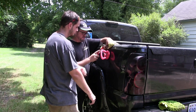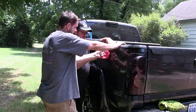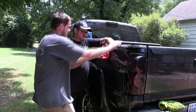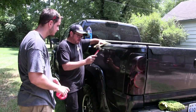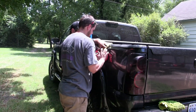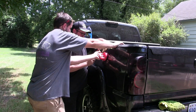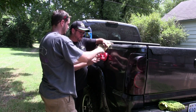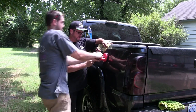I've went around and relaxed the metal, and now I've got him put the suction cup on. I'm going to continue hitting that metal, and then I'm going to have him put a little bit of pressure on it. I'm hitting right on the top of where that crown was — that eyebrow — to push the body line up, because if you don't do that, it's not going to pull out near as easy. He's pulled some out, and now we're moving down towards the center of the dent — the bigger portion. You always want to work from the outside and work towards the inside. I'm stress relieving again to vibrate the metal, and as I do that, he's pulling on it, and that's helping get that dent out.